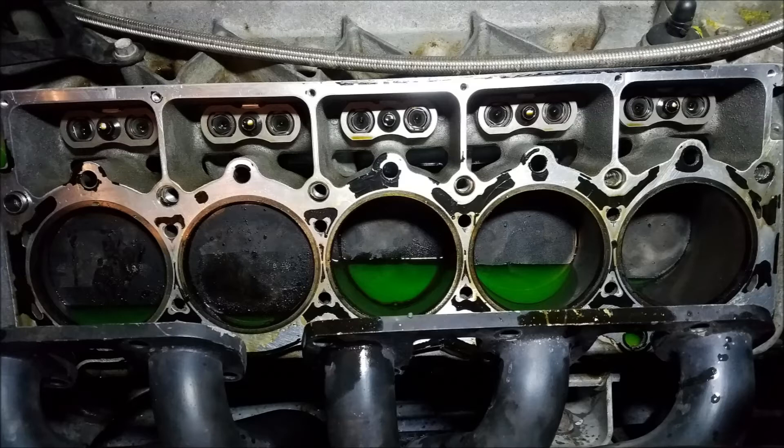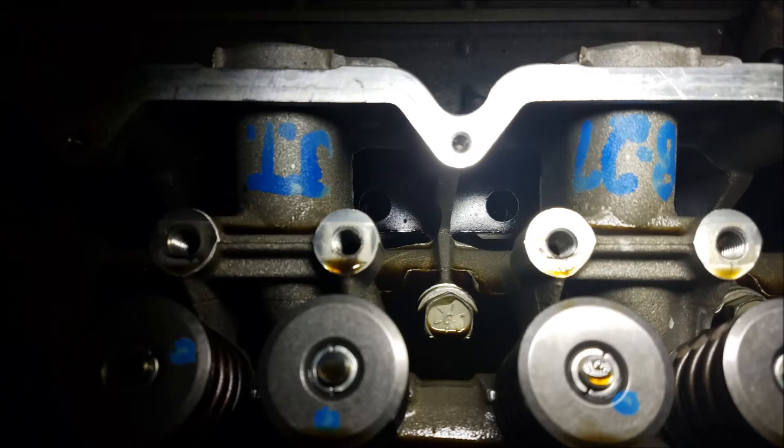The head gasket stuck so I had to scrape all that junk off — a lot of fun in the most sarcastic of ways. If you look closely, you can see the push rod hole in the head gasket was rubbing against the push rods. The upgraded replacement gaskets are a better design — several sheets of metal stuck together with much bigger push rod holes — so there was no touching at all when I put them back in.